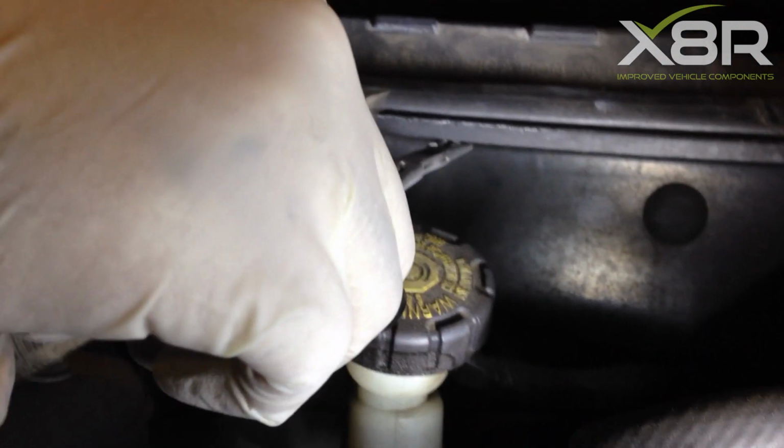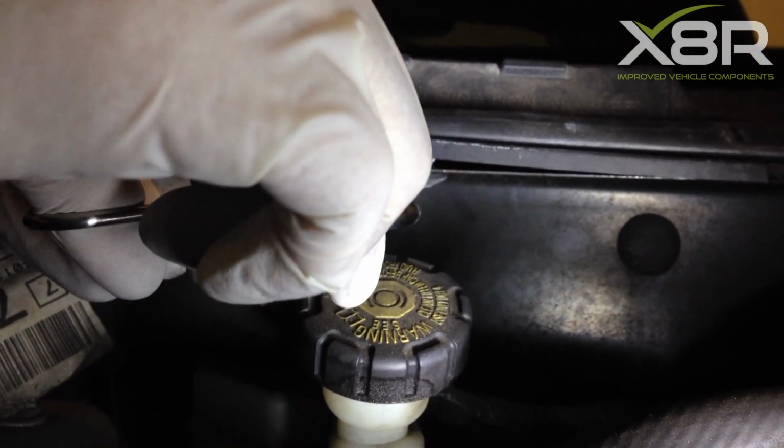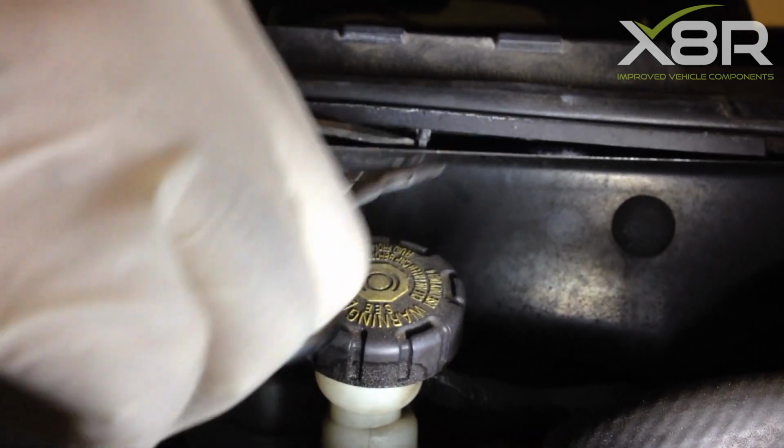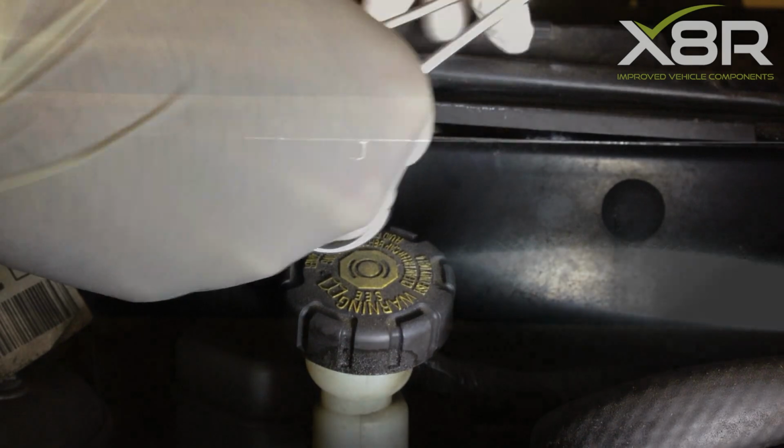One last thing to do before removing the scuttle panel is removing the lower clips. Using a small pair of grips, clip in and then using a flat-bladed screwdriver, lever the scuttle panel out and leave the scuttle panel up.